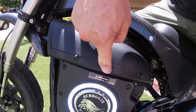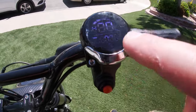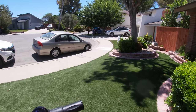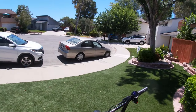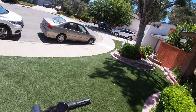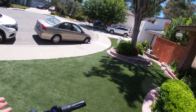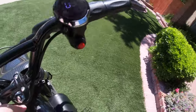One of these bolts is a false bolt with a hole through it, and inside is a little button. You push through it with a pen, tack, paper clip, or toothpick and it switches modes. The display shows 'S' when you're in saver mode - push that button and the S goes away, meaning you're in high mode. Saver mode restricts both your low and high speed thresholds; for full max power you need to be in high mode. Within each mode you still have the high/low toggle, it just raises the thresholds in non-saver mode.